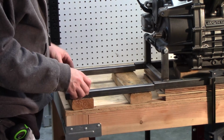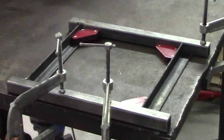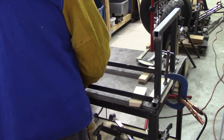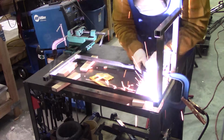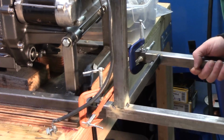I started out with the left side of the test stand. This piece, along with the rest, would be removable so the engine could be easily removed. It consisted of two parallel square tubes on the base, connected with two pieces of angle iron, and two tall angle irons on the back connected with another square tube. I cut the square tubes and angle iron and started with welding the base. I then added the tall back angle irons and welded those in place.